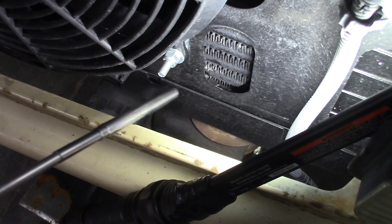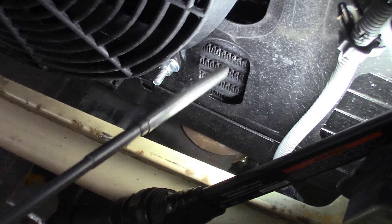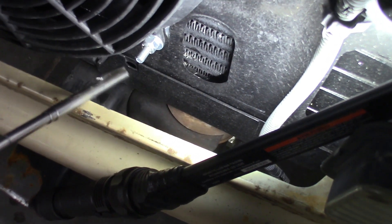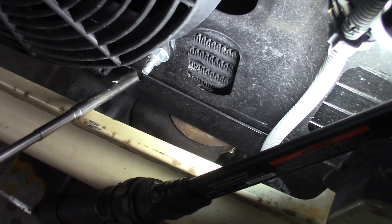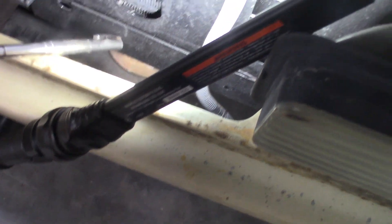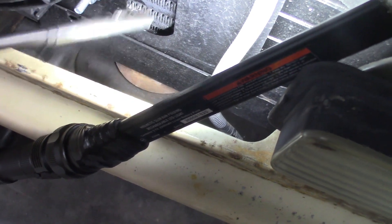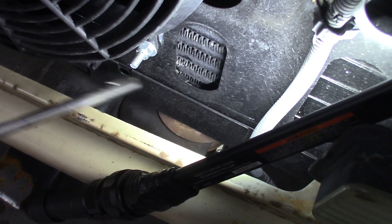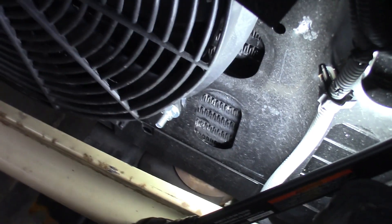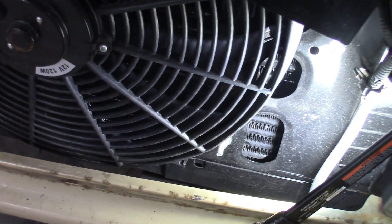When you have those out of the way, that lets the intercooler set up against the core support. There's a little shelf right about where this hole is — it runs the whole length of the bottom of the core support. And the Dodge intercooler has two pegs that stick down off of the bottom of it. Take an inch-and-a-quarter hole saw and drill two holes to allow those pegs to sit down into the core support. You will also have to cut a hole right where your body bolt goes so you can drop it down and clear the intercooler. Once you have that dropped in place, that's it for the bottom — just two pegs inside the hole. Then you can fabricate those top brackets like I showed you. That pretty much covers the intercooler.